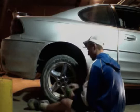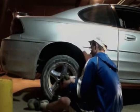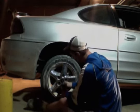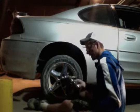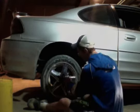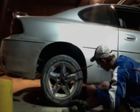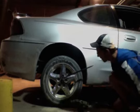Just wiggle it around sometimes until you get it stuck on the lug nut. Keep going until you can see that the tire is seated clear into the caliper. Once you have them on with a wrench like that, then you can go back to your tire iron and tighten them harder to make sure they are tight. Now you are going to lower your tire back down so it can't spin and you can get more leverage.